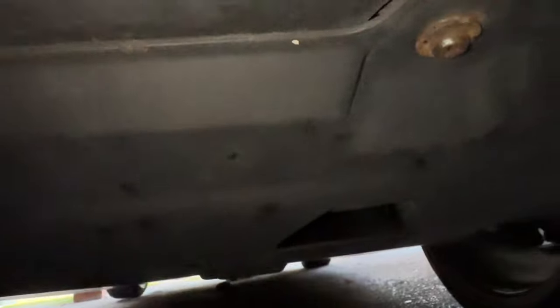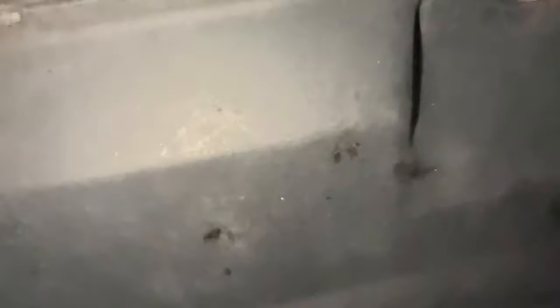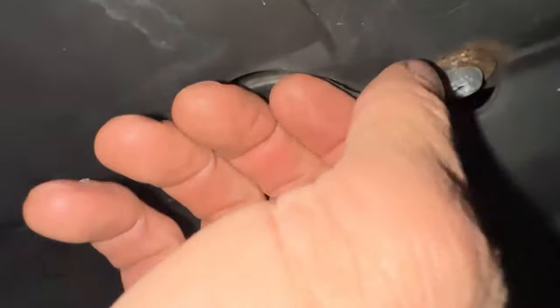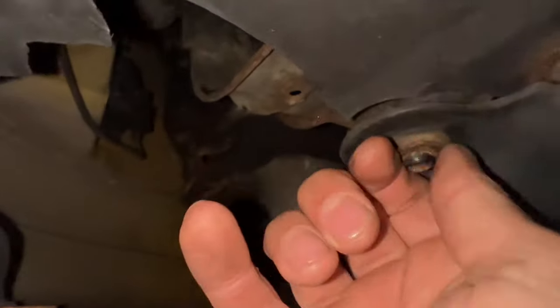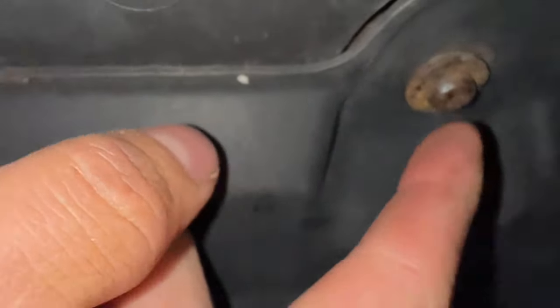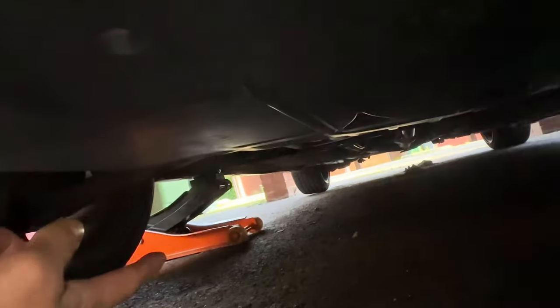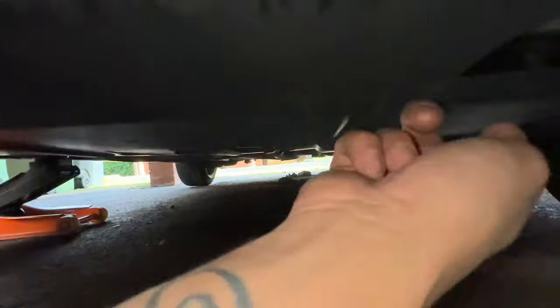I was hoping I wouldn't have to get the car in the air. I usually put the jack underneath on the gearbox, but unfortunately there's an under tray on there so I need to take that off to get to the gearbox. The under tray is held on with some fixings — those other two were hand tight but this one's stuck. I think it's a Torx. That bolt there was just hand tight, and this one was just hand tight too. So this one's the only one done up properly. I'll drop this off and I'm assuming there are some at the back as well. I'll get axle stands in first before crawling under, then take the shield off and get to the gearbox.